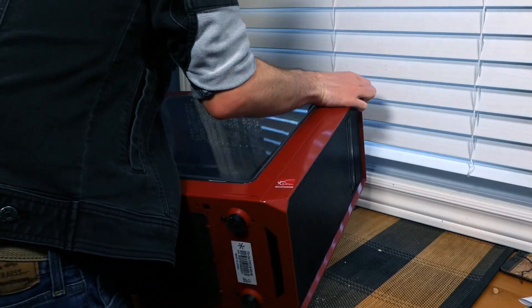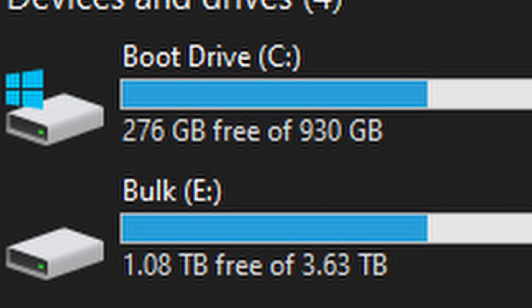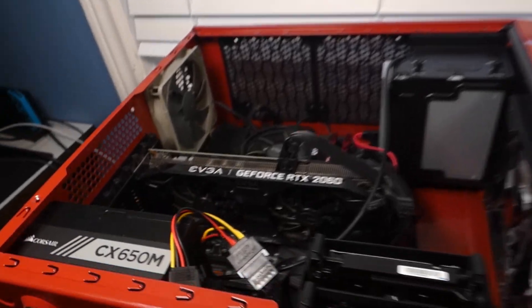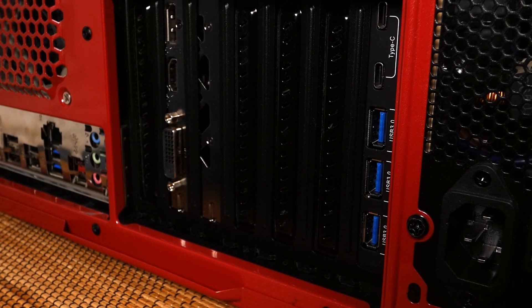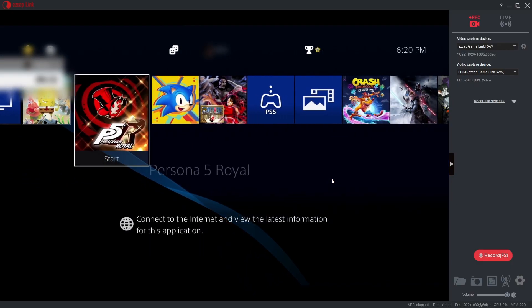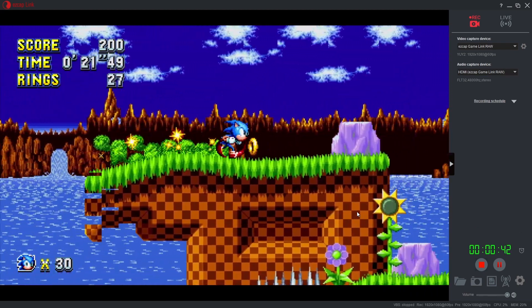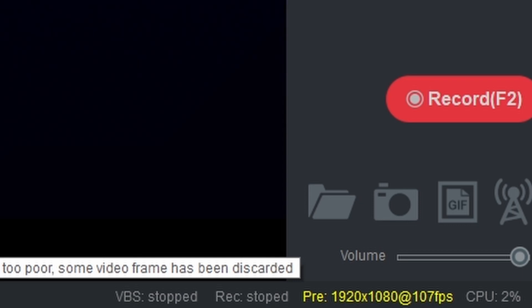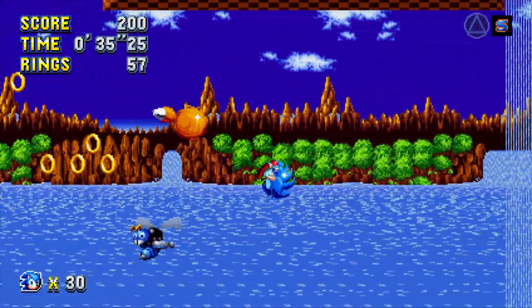So from what I gathered, it's possible this is a Windows-related issue — either how Windows handles USB or UVC — but that's an uneducated guess. I didn't want to install a new OS just to use this capture card, and I'm currently out of hard drives and disk space. So, knowing I'd get different results with something other than the rear I/O ports, I just bought a PCIe to USB 3.0 hub. Sometimes the answer to your problem is just to buy something. Sure enough, once I opened the Gamelink software — 60 FPS. When recording, I observed no desyncing and no audio issues like I had with the front USB port. The only issue is I still can't get 120 FPS in Windows, but I only really care about 60 FPS in YUY2, so I'm very happy to get this working.